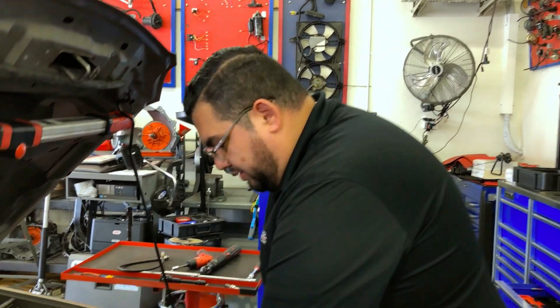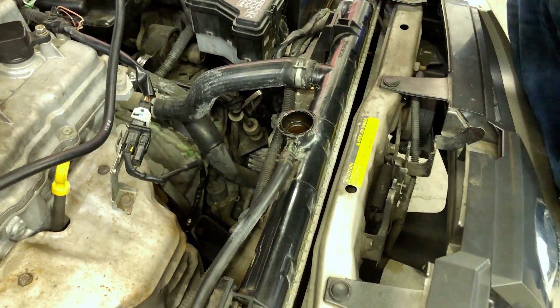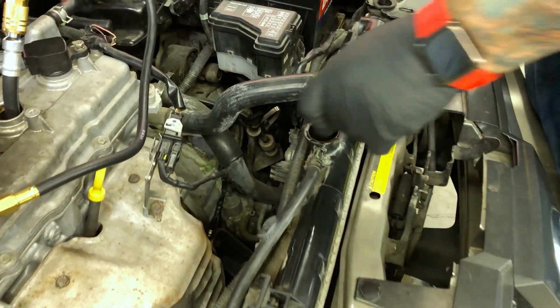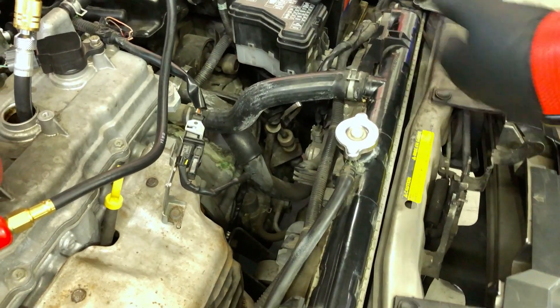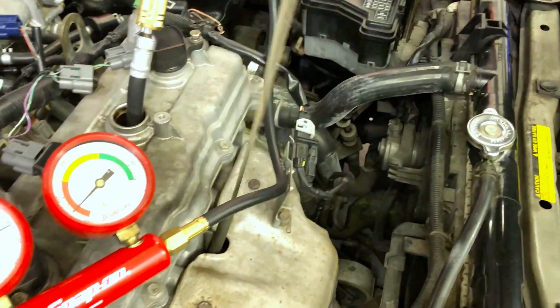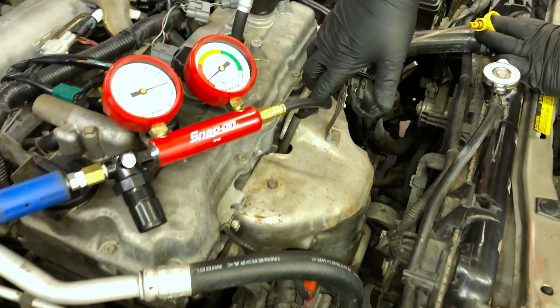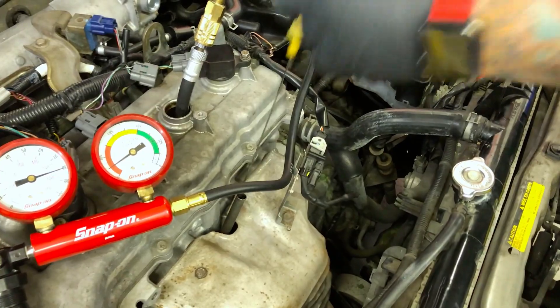One of the things you can do is remove the thermostat and the radiator cap. If you see any bubbles coming out of the radiator, that usually indicates a cracked block or a blown head gasket. We don't have any bubbles coming out of there, so we would say that is okay. The next thing you want to do is remove the dipstick. If you remove the dipstick or the oil fill cap and you see any smoke or noise coming out of there, then you know for sure that it's piston rings.